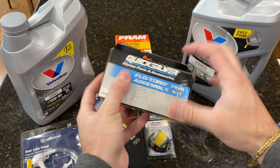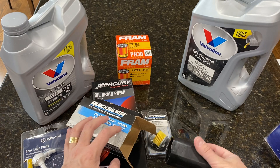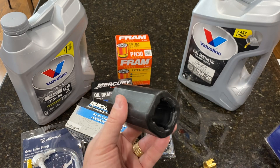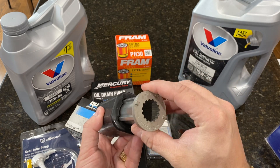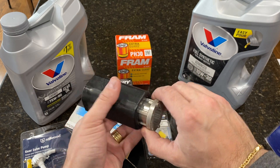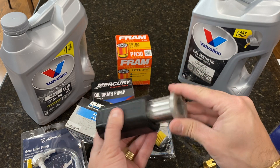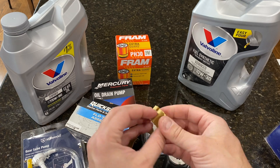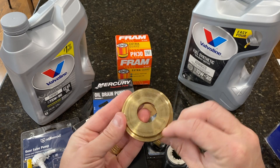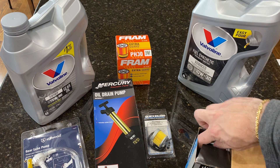This is the hub kit. Let me open this quickly so you can see what's inside. You have a couple of parts here — this is the main portion, the plastic sleeve. Anytime you have a problem, this is the part that needs to break before you get into trouble. There's also the metal part that goes inside, and all of this goes into the prop. If the motor or prop gets stuck, this will rotate and break loose to protect things. Mine had a couple of cracks so I decided to buy a new one. You also get a new nut — there are many different kinds, so verify for your engine and make sure you purchase the correct one.